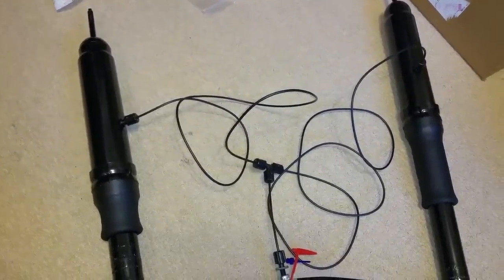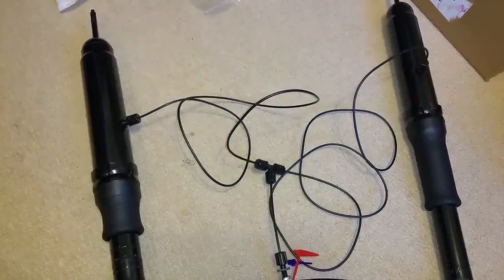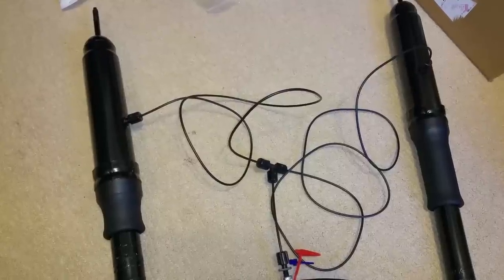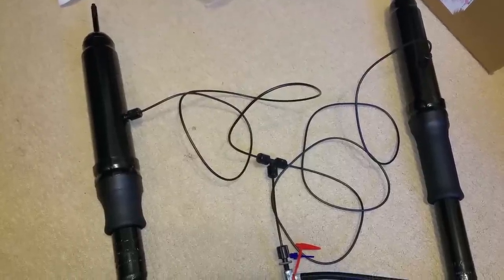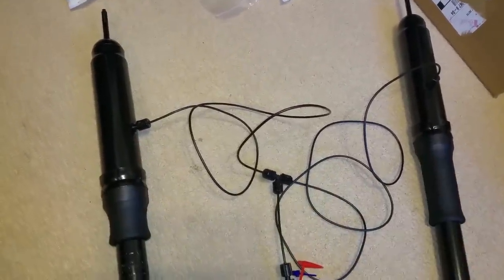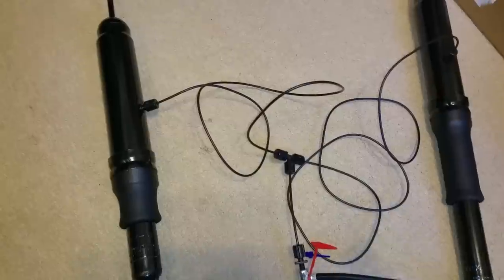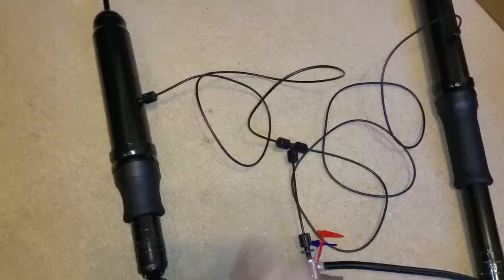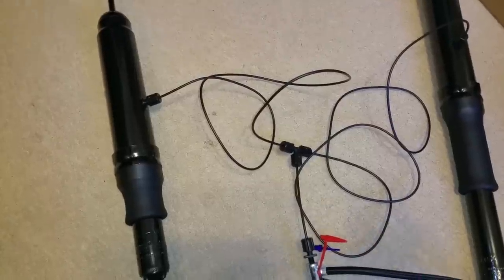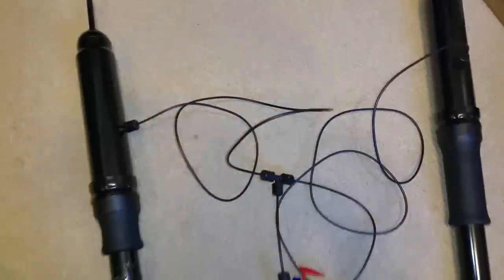Eventually I'm going to look into buying one of those wireless air kits from Airlift — a company that's been around for well over 60 years. They have a manifold where you connect each spring separately so you can control each spring with its own set pressure and they don't bleed into each other through a T-fitting. That's a pretty expensive setup, but it's actually quite simple to install.